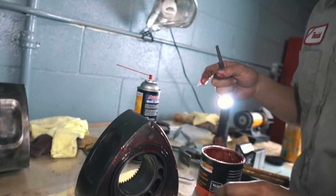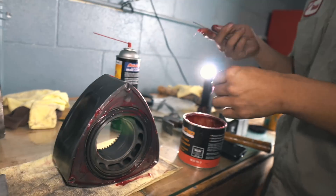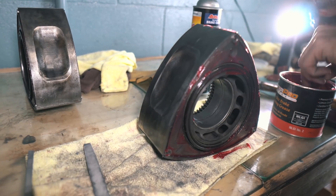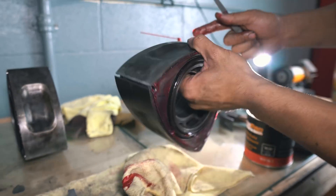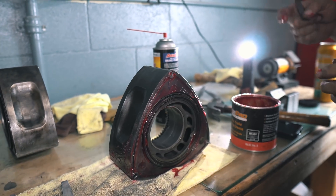We've been holding files for hours and now it's just a part of you — you are one with the files. That's not normal but it happens every now and then, where the corner seals are just not machined right or just a little off. Every apex seal company makes them slightly different sized, so any time you jump around brands you have to clearance everything.